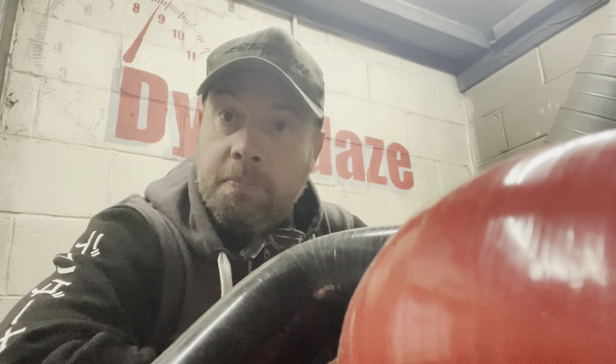Right, let's get this video finished. So the Mitsubishi Colt Rallyart — it's only got a panel filter and a few silicon hoses, but it's mapped out really well, which we expected. It's finished on 194 brake horsepower — pretty much what we expected to see, 190 to 195 — and around 220 foot-pounds. It's going to feel like a different car, night and day really. These map up really well, and with a few mods they do even better.